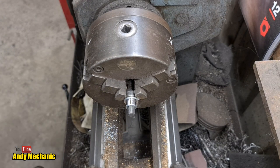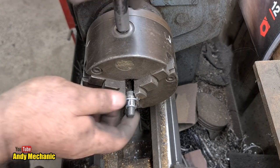Right. Back to the bench. I wonder what that motorcycle was then. It's still the DR200 that I stole the clutch cable off this morning. Okay, so we've got these, but I can't get them onto the cable, so I need to do that 2.1 mil slit again to be able to offer it onto the cable and slide it up and then pull the whole thing together. And then once it's all tensioned up, pretty sure these will stay in place. Slit disc over there. Right.